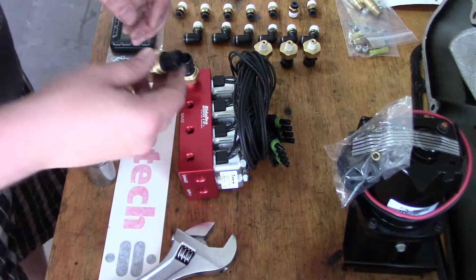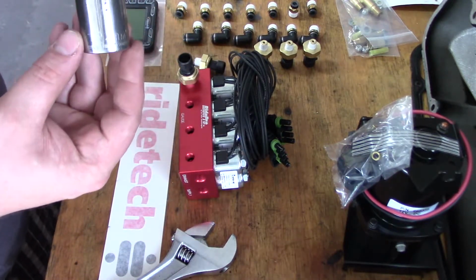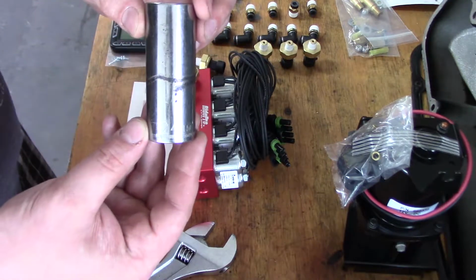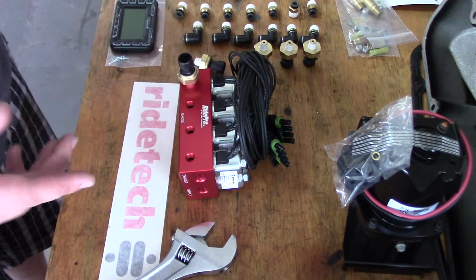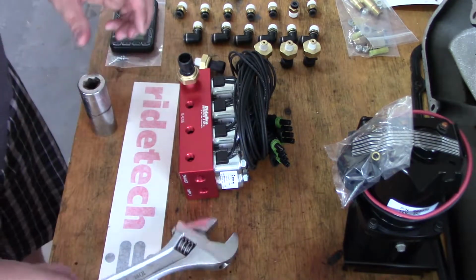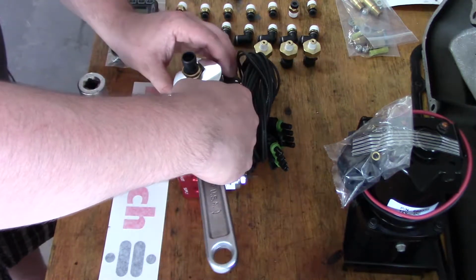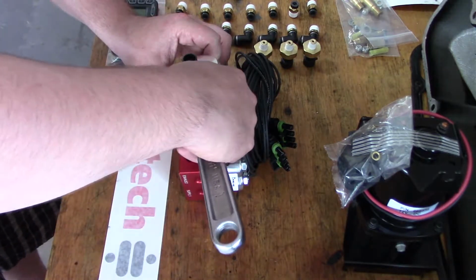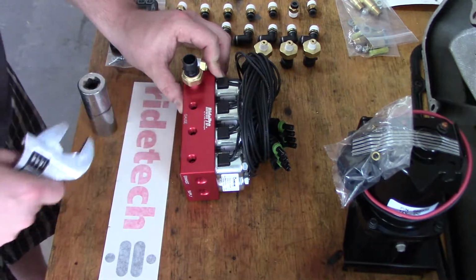Well, I got a sensor put in here, and it appears that they are 24mm metric. And I'm going to use the socket. It's a deep well, a standard wouldn't fit, but if you didn't have that, you could use an adjustable wrench. Just be careful, when I'm tightening this down, I don't want to run the tool into the nice powder coating on the aluminum.